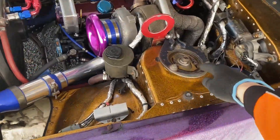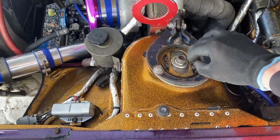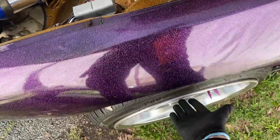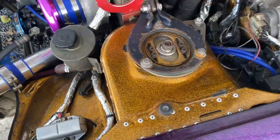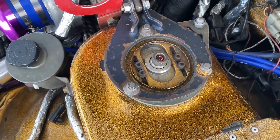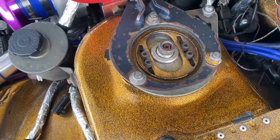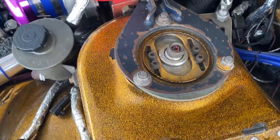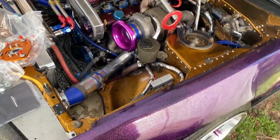The top of the coilover — when they've got adjustable camber things like this, camber plates — I'll just show you what happens if I lift the wheel and have a look in there. You can see that that moves, and imagine that happening a lot. I'm going to be eliminating that today.